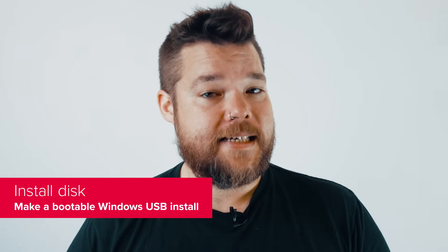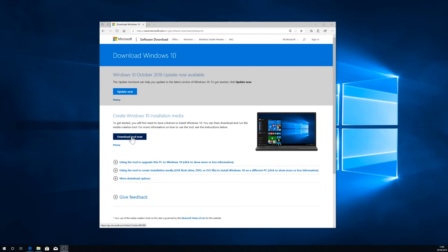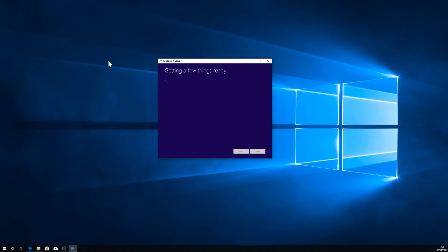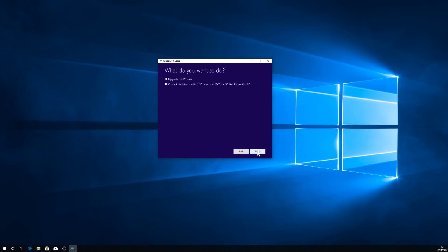Given the lack of physical media drives in today's machines, booting from a USB stick will be your best bet. It needs to be at least 8GB in size to fit the Windows install on there, and be ready to be completely formatted — you will lose all the data that's on there at the moment. Then you need to download the media creation tool — the link is in the description below. Run the tool once it's downloaded and it will spend a little time spinning its dots getting a few things ready. Accept the license and then click the option to create installation media. Make sure it's set for the 64-bit version of Windows, and choose the USB option.